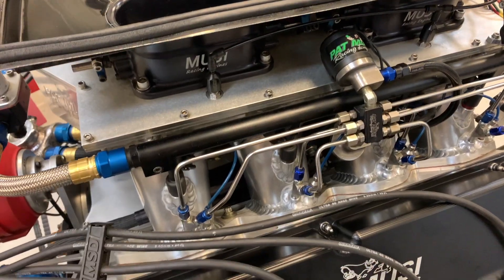So you start getting into extreme applications — high temperature, high boost. Engines on the edge, whether that be NASCAR or whether that be Pro Mod. Five stages, 10, nine — whatever they're using these days on a Pro Mod. 60 pounds of boost, 5,000 horsepower — it's on the edge. We live in the world of boost. You put a Pro Charger on it and hook that belt up, all of a sudden horsepower and torque is just there — just like opening the spigot. When you're making that kind of power, you're making more heat, more pressure. It's easy to have an oil ring lose tension.